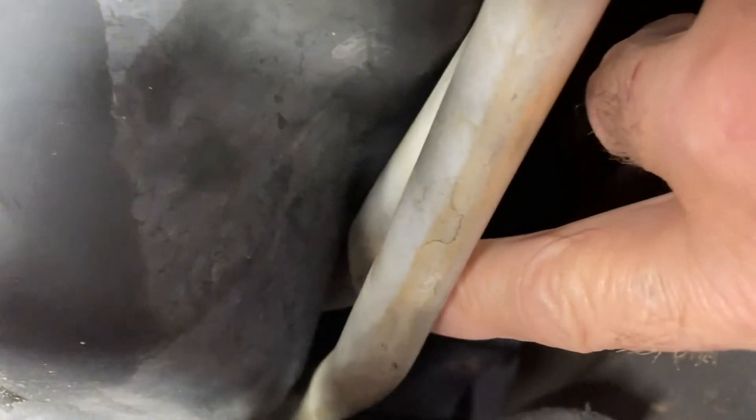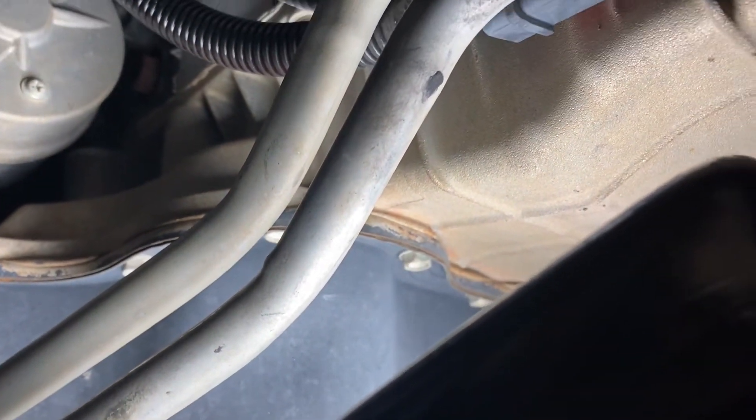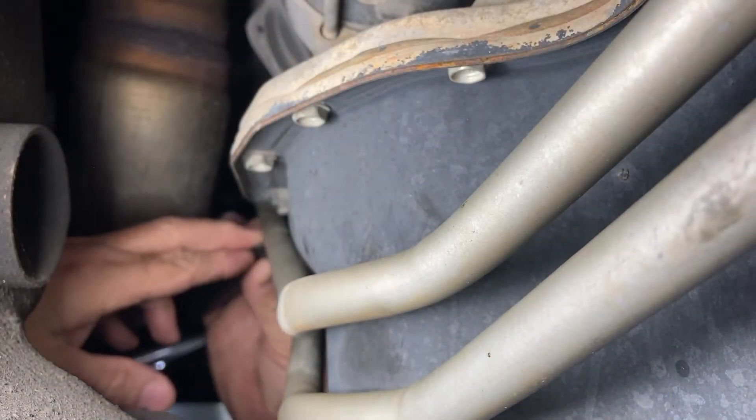Here's the angle from the front passenger side of the oil pan. This is going to the radiator and coming from the transmission oil cooler, and that's going back to the transmission. So it's this top line right here that is really super close and is actually rubbing. This is the top line and it's the closest.